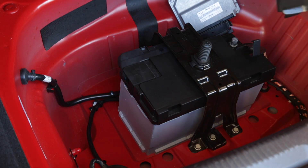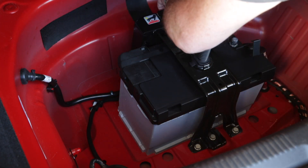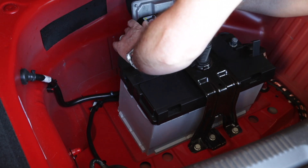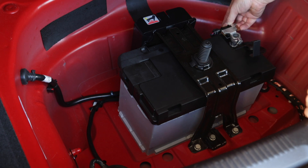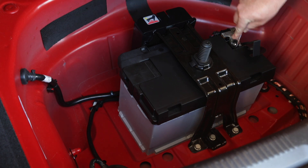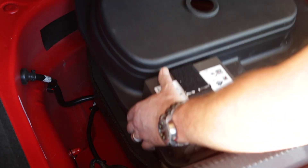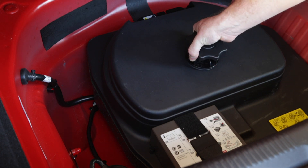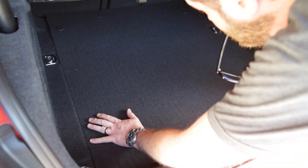It's much better to use multiple points and gently tighten evenly. Slide the ECU bracket back onto the battery's accessory bracket and then mount the ECU in place — it simply clips right in but it may take a bit of fidgeting, so don't force it. Attach the negative side lead and snug it down. The foam accessory tray goes in next, followed by the cover. Using the large nut, spin it clockwise to lock everything down. Replace the trunk carpeting and congratulate yourself on a job half done.